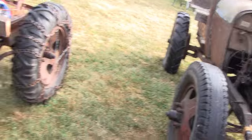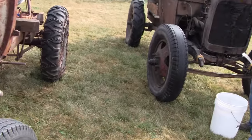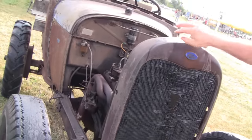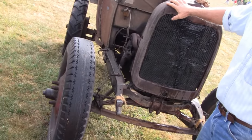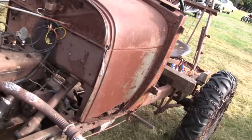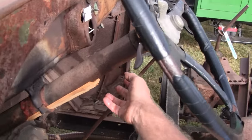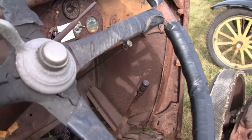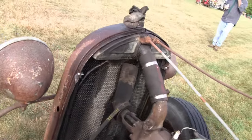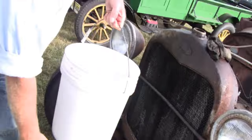Well, this one — from the shape of the radiators — they're earlier than a '28 or '29. That shell is not the original shell to this. The dashboard plaque has something to do with it. I think these are early, early '20s because of that dashboard. I can only tell by the radiator shell and the running boards, and this just doesn't have any of them.